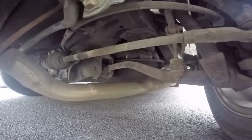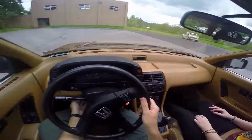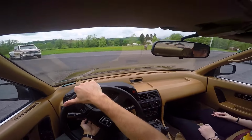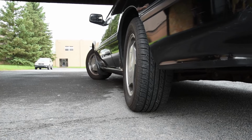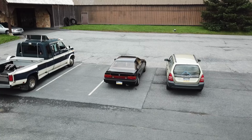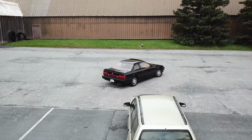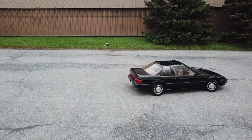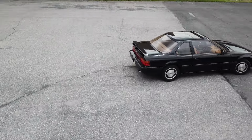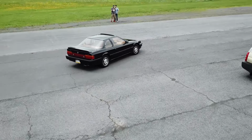And because the Prelude 4WS is just gears and rods, the rear wheels will turn no matter what. Once you turn the steering wheel past about 80 to 90 degrees, those rear wheels will turn at any speed. It's VTEC for steering. When you turn the steering wheel in the beginning, like when you just begin to turn it off centerline, it feels just like a normal car because it is a normal car. The rear wheels aren't doing anything yet, but once you pass the engagement point, the car starts turning 2 times faster even though you are turning the steering wheel at the same rate.